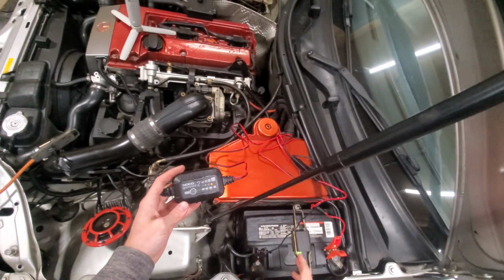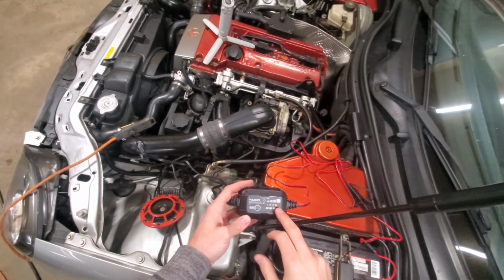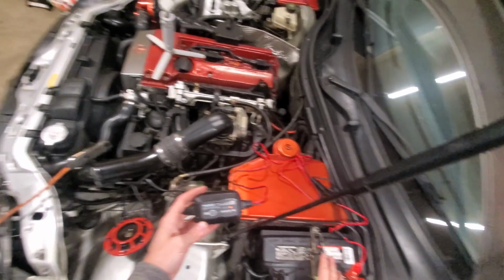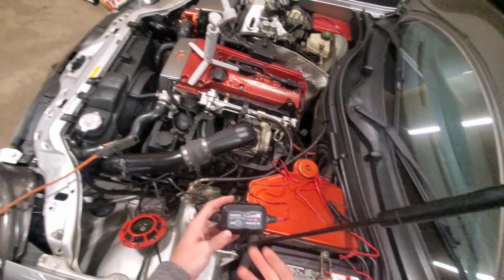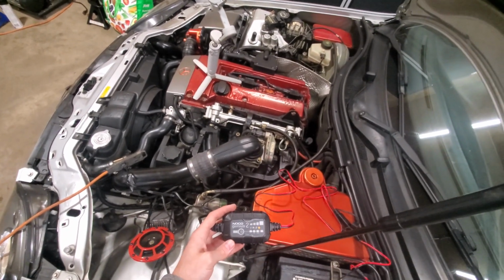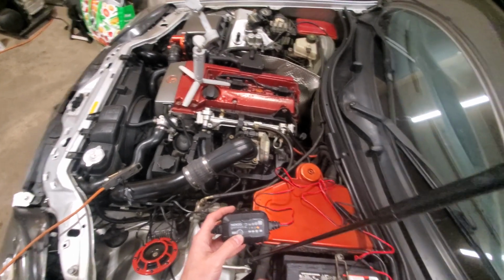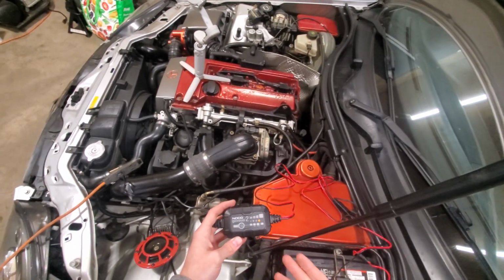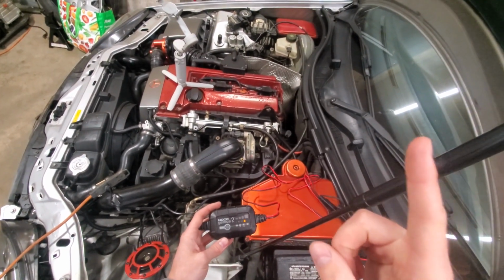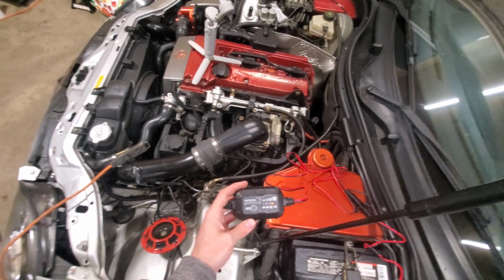Now, once you plug the charger in and have all of the clamps connected to your battery, if you're just seeing a standby mode and nothing is actually happening, it's very likely that your battery is below 1 volt, or the Noco Genius 2 is having a hard time detecting the battery. At that point, you're going to want to go into force mode, and to activate force mode, you're going to hold that button for 5 seconds. If you want to see a more in-depth description and how to use that force mode, be sure to check out the other episode I've done up in the link here in the corner, or I'll leave the link down in the description below for that episode.